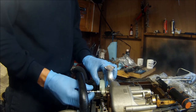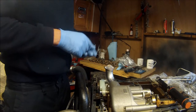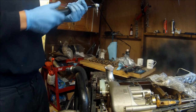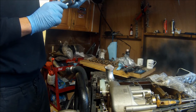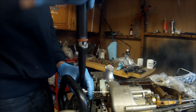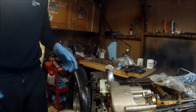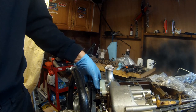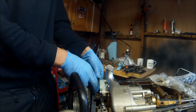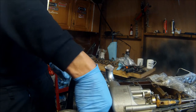I'm just going to put the bolt back in for the chain guide. The torque setting for that is 9 Nm. I stopped the camera because I went and triple-checked the Vanos pump about another three times, keeping moving it round just to be 100% sure it is set right. It's been known that if the gears are set wrong it can actually destroy the gears. And you can actually feel a little bit of play in there now - it's obviously tight but you can feel some play, whereas when I took the engine apart there was nothing at all.